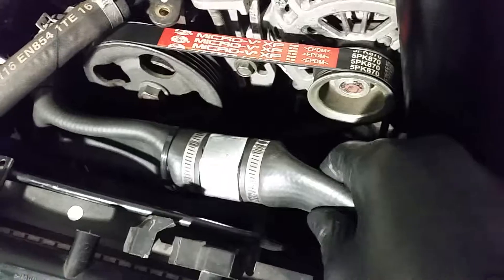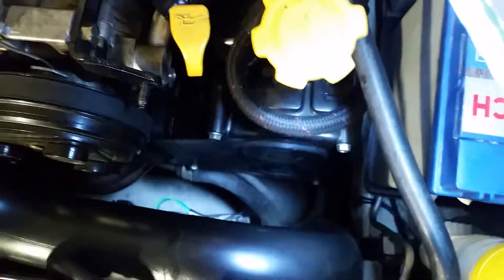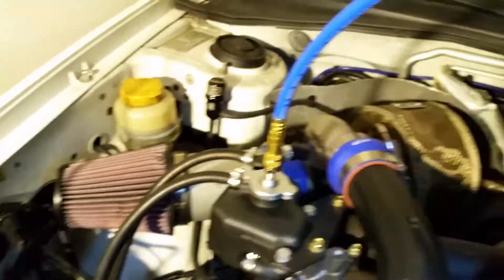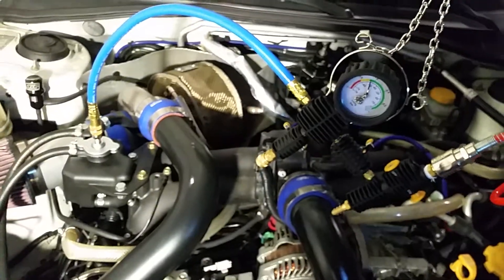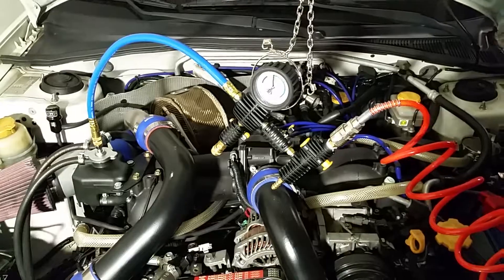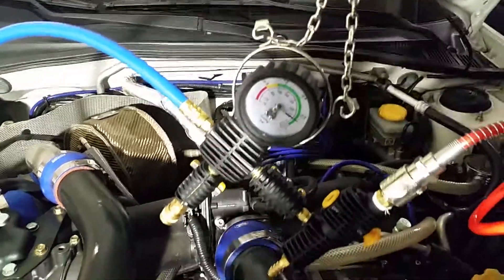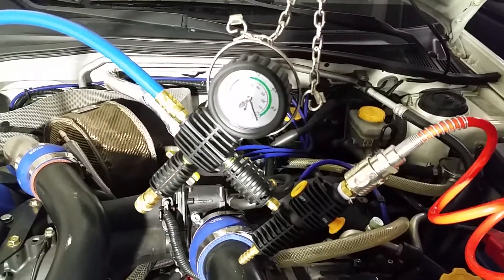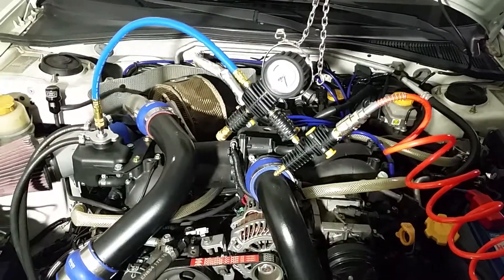If you look at the pipes or the radiator, they're completely sucked in. I have a super vacuum now in the system. You can see if there are leaks and you can see it's just holding, which is good. My thermostat housing is not seemingly leaking — I did both pressure and vacuum. You just wait here for like three or four minutes and see if anything changes. I've already done this so I can release it — I just open this back up and release the vacuum. So now you know your coolant system is not leaking, there's no bad head gasket leak with both a vacuum and pressure test. I can do the next thing, which is refill it.